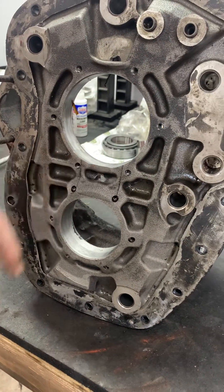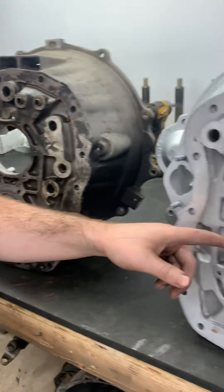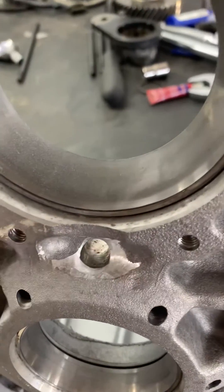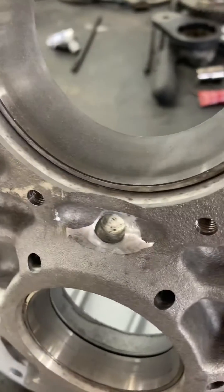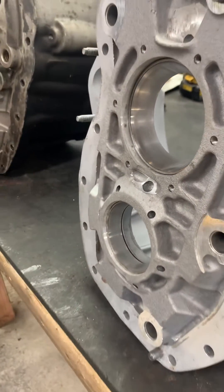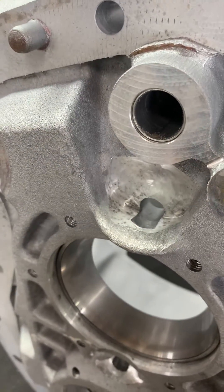It can hinder the actual oil getting to the counter shaft. And if you come over to this one over here, we've taken a deburring bit and cleaned that up, making a better shelf to catch that oil that's being swung around in there, just to improve the flow to the counter shaft as it comes in through the input retainer.